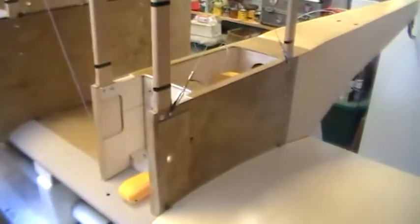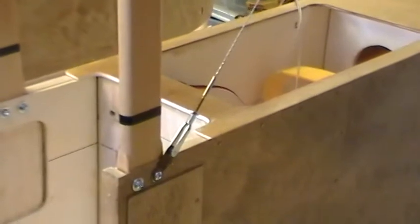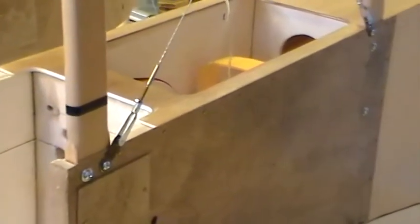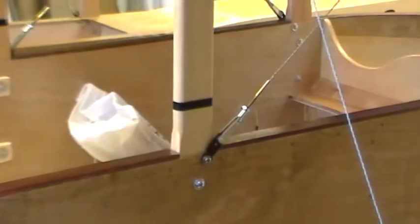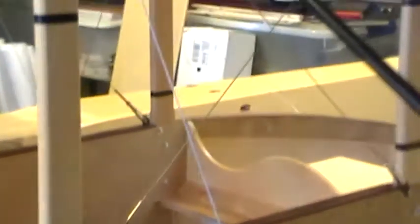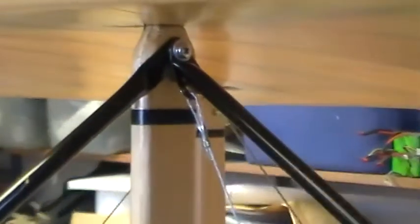I'll show you some close-ups of some stuff I've already done. You can see the different connections — that's with a clevis and then the swedging at the top. I've done quite a bit on this airplane; it's probably going to take somewhere between 200 and 300 feet of cable. The system works real good, it's good and solid. You solder one end into the clevis end and then you swedge the other end. If you start out with good tight cables, they don't take a whole lot of adjusting after flights because there doesn't seem to be a whole lot of stretch with them.